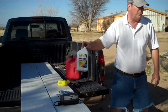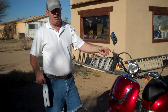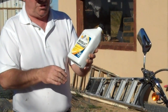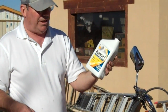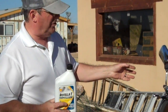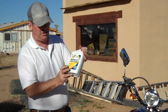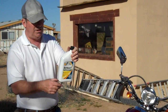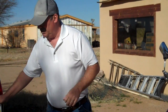The machines come with the proper weight oil in the little gearbox back there, and this one takes like 100cc — just about that much oil. It specs out 15W40, which is kind of an oddball viscosity. Not knowing exactly what oil came in this thing, and as my understanding it's pretty cheap oil, after about 10 miles I drained it out and put in Rotella T. This is mostly used by diesel engine owners — very, very tough oil, 15W40. I might switch to a synthetic blend come summer, but it's like 120 degrees down here.